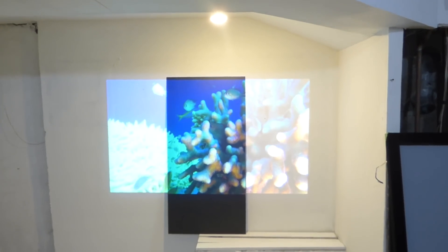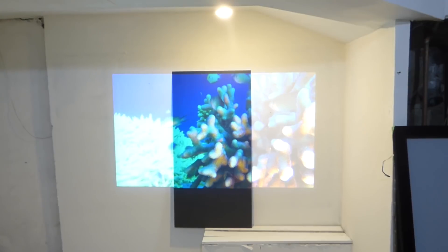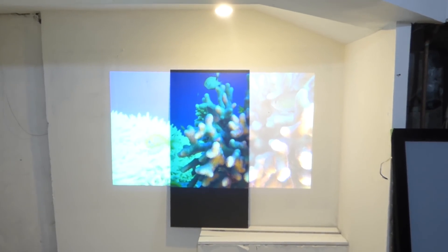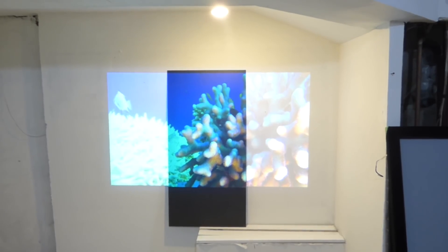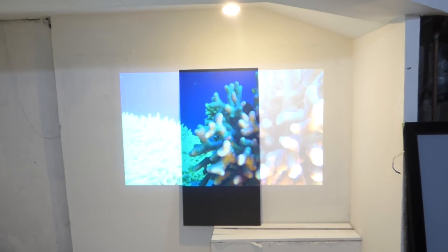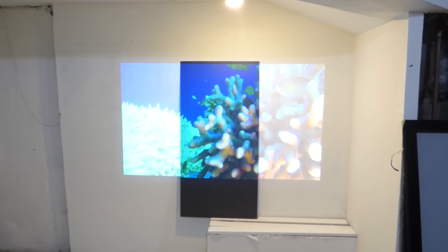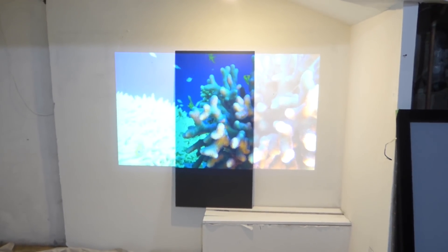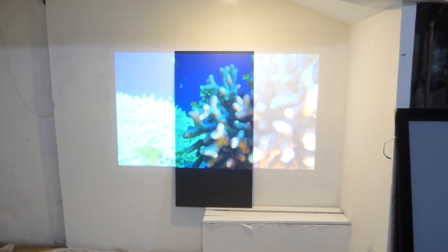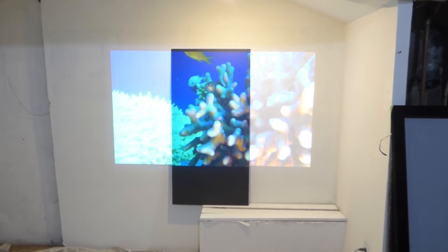If you're using a white wall or light gray screen, one of the problems you're going to have is something called white wash. White wash is basically when a screen produces such a high white level that if a projector of 3,500 or 4,200 lumens — which are used for commercial use — hits that screen, it's going to completely wash out. It's going to produce too much white level. You need contrast in there to add more depth, more detail, and contrast helps to control and lock in a lot of light. Basically, it's going to wash out the screen.